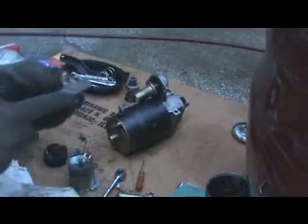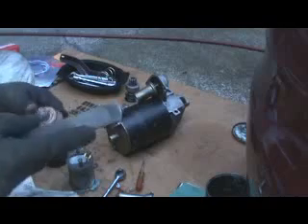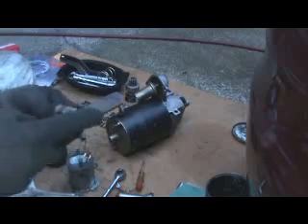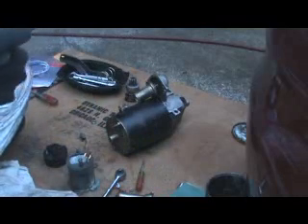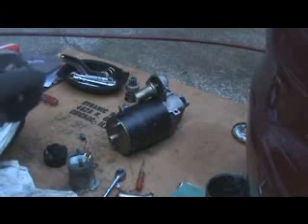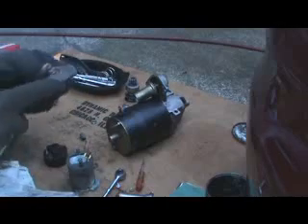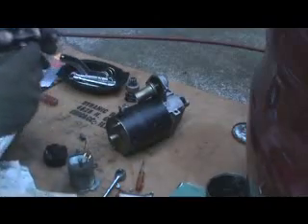All you do is simply file it. It doesn't have to be pretty — just file it off and get that roughness off of there. That will extend the life of your solenoid for many years. Look how that's cleaning it up. See that compared to the other side. It doesn't take much. Much cleaner now — that adds years to your solenoid right there.